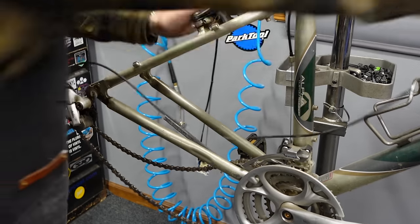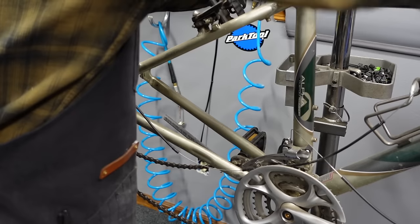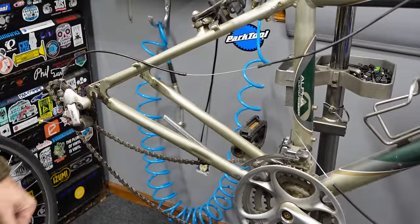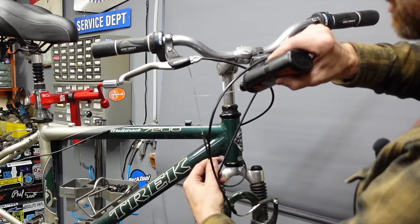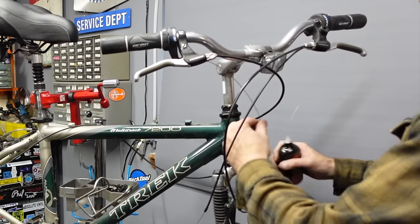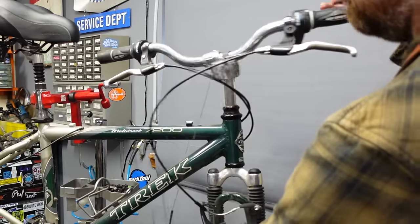Do that all the way up. And if you're lucky, you can do the same thing by holding the front derailleur out, disconnecting that piece, doing the same thing. Now all your cables are loose on that bike. You have really good access to the frame this way for polishing and cleaning, and you can lube all your cables. For lubing the cables, I use a little bottle of Tri-Flow. I just let gravity help me out — squirt a little on the cable, let gravity pull it in. You can take your cable housing way down. Just a couple drops is really all you need — a little dab will do you.